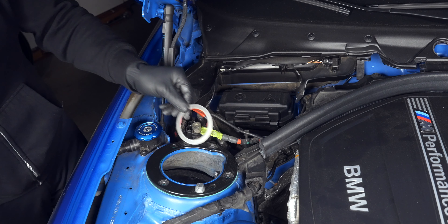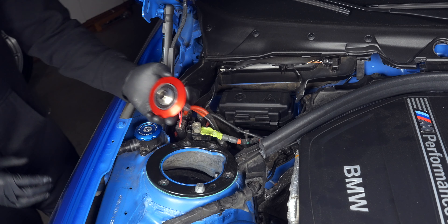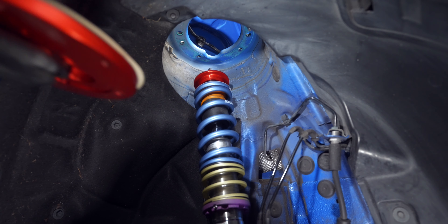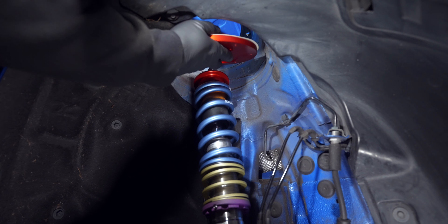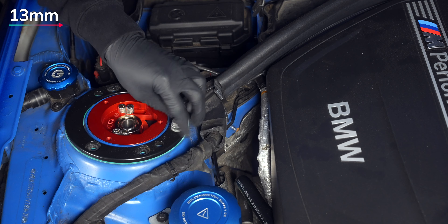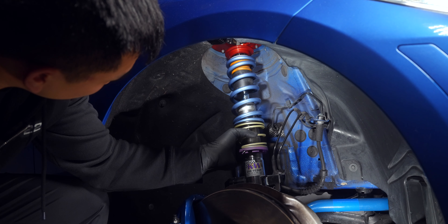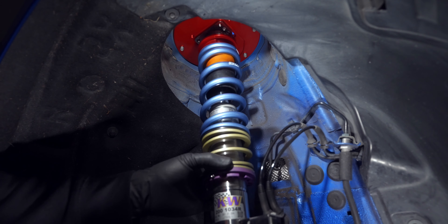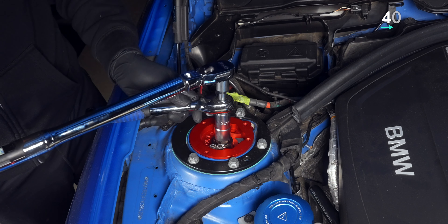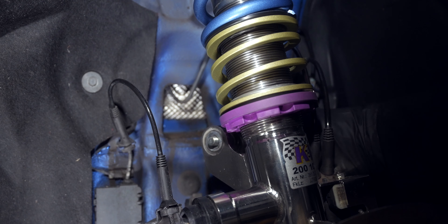Since we're still operating within the KW height recommendation with a stiffer spring at almost the same height, bottoming out the shock shouldn't be an issue, while preload will be car and spring specific. With this 8kg spring on the M235i, we should have about 2 inches of compression from just the weight of the car if set with zero preload. Although I doubt the suspension will ever be at full droop while driving, I'd still like a few spins of security — and having the helper spring there definitely achieves this. Plus, having the main spring slightly compressed with its stiffer nature will give us more traction on the road.